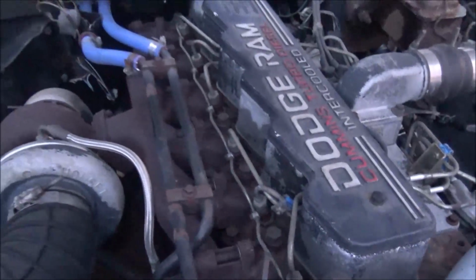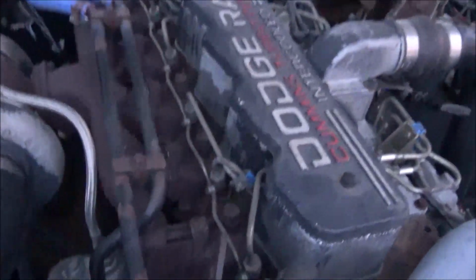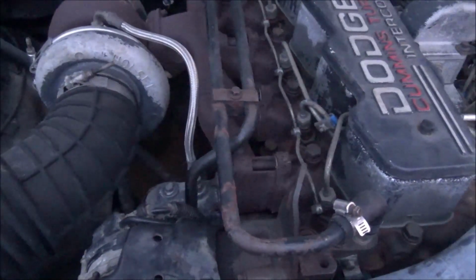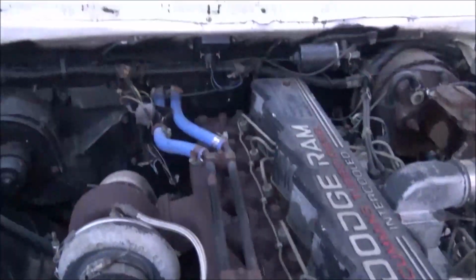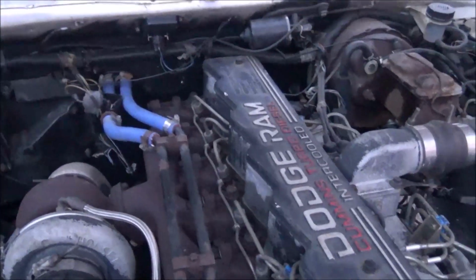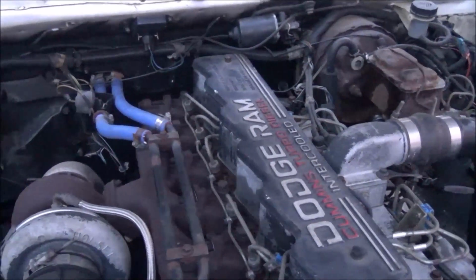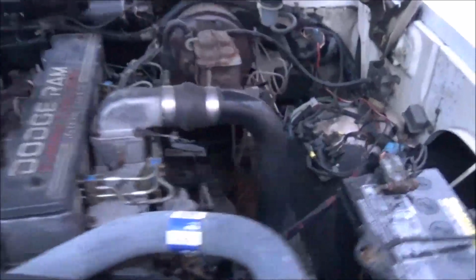It's maybe a little high on the amps charging at idle speed because of the field strength needed to get the output. But I don't know if that's really a huge issue, because most of what I looked at online said 5 amps would not be unusual, so 5 to 6, especially on a big alternator. This isn't a Toyota, this is a 120 amp alternator, so it's quite a bit of output. So I don't think that would really be it.